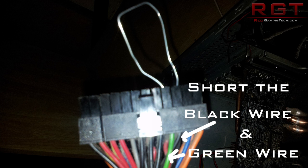It's going to be either 20 or 24 wires in one depending on the age — you can see it on screen now, it's fairly distinctive. Once you've found it, just squeeze the clip and pull it out. Be careful you don't want to wrench too hard on the motherboard and bend it. Then once it's out, you're going to need to find yourself a paperclip — yeah, that's right, a paperclip.